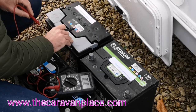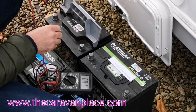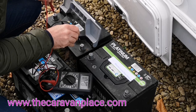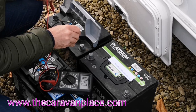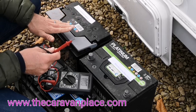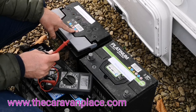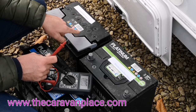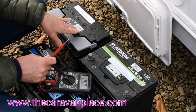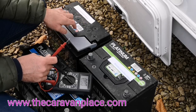We've got the lead acid battery now — that's showing a really bright green indicator, which looks absolutely perfect, so I'm expecting a really good voltage on this one. Oh — I've got 10.2 volts. So this has already started to really deteriorate. We're going to struggle to actually recover this battery. Once we've gone below 12 volts, it's pretty much curtains for the battery and it will be very, very difficult to recover it for any real usable time.